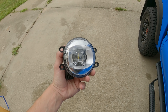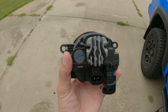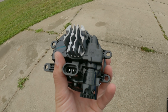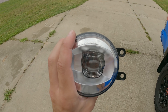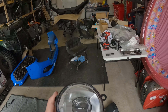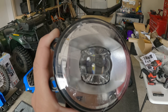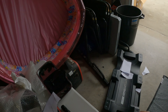An important part I couldn't find any answers to online: these are the upgraded LED fog lights with the H11 plug. A lot of people said you can just take the bulb out and install it in the halogen housing on the ARB bumper — that is not true. This is all one piece. The bumper came with attachments to go into the fog light assembly, so my goal is to try to mount these inside the new ARB bumper. I'll let you know if I can or if I'll just have to put LED pods in there.